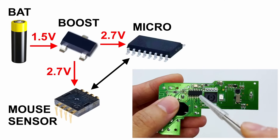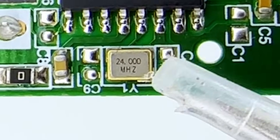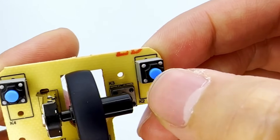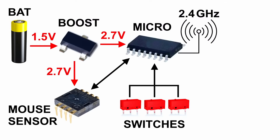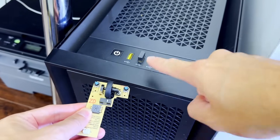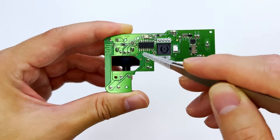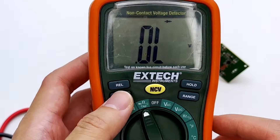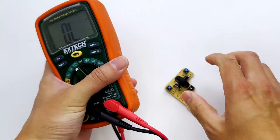The mouse sensor connects to the microcontroller, which is the brain of the entire system, and uses a 24 megahertz crystal for its internal clock. All the switches for left, middle, and right clicks, as well as changing the DPI, are all connected to the micro. Lastly, there's an antenna circuit used to wirelessly communicate with the USB dongle on the PC, to send all the mouse click and movement information. Now we get to the boring part where I need to confirm every connection between each individual component using a multimeter — every time it beeps, it means there's a connection.